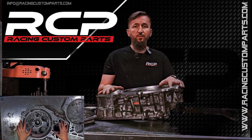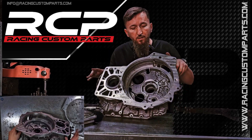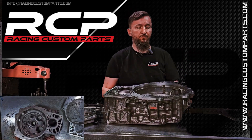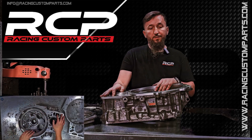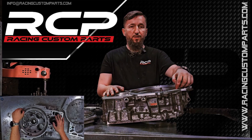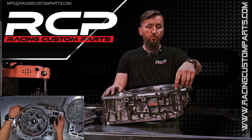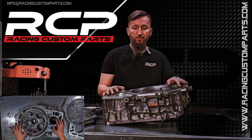If you're doing this yourself or having someone do it, before installing the adapter, first mount the bell housing to the transmission, then bolt the adapter on. It's because of this bolt here — this bolt won't fit through the adapter. So if you receive a ready-made adapter from me, unfortunately you'll have to remove it, mount the bell housing to the transmission, then reinstall the adapter again. I can't remove material here because the adapter's structure remains rigid only if the adapter is one solid piece. If I weaken it here, it will start to shift and move and no longer serve its purpose, so unfortunately it must stay like this.